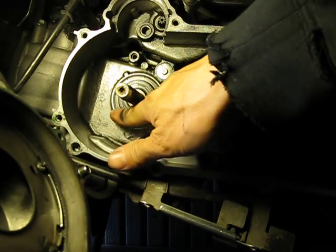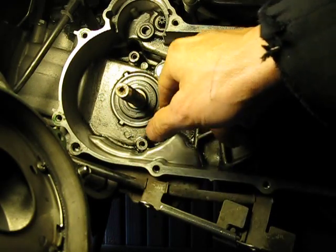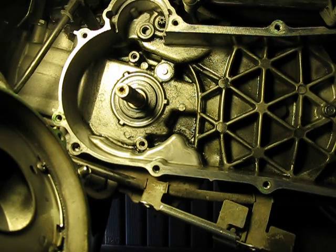Don't be lazy like me — don't overfill it, and if you do overfill it, remove some of that extra oil using a little straw or something like that to extract it from the engine. If you do that, you won't have this problem. But like I said, this bike has over 41,000 miles and I'm expecting quite a few more miles out of it. Who knows — if I keep it long enough, maybe one day this bike will see 100,000 miles, and I'm confident that it can.